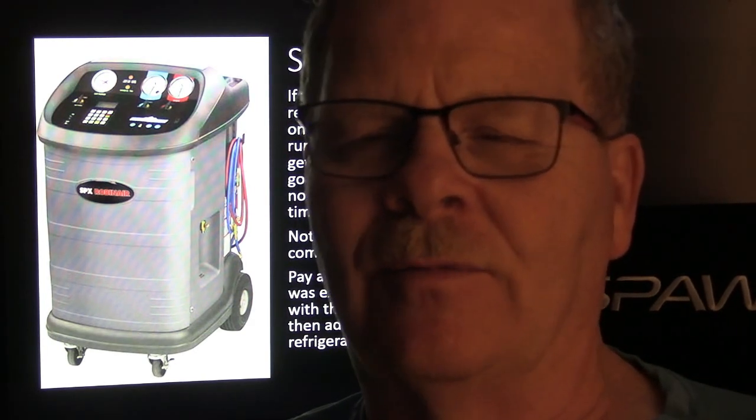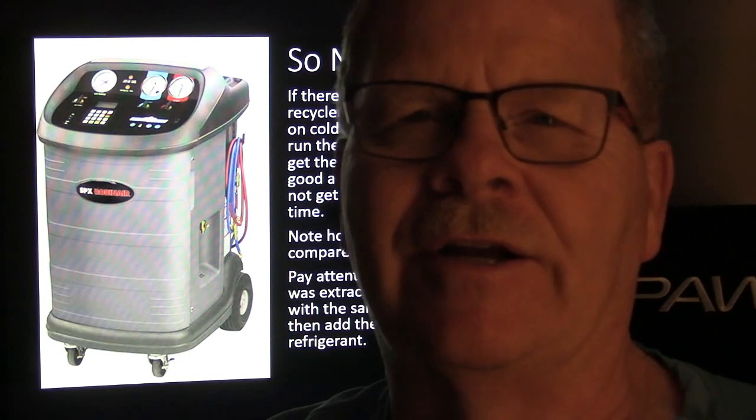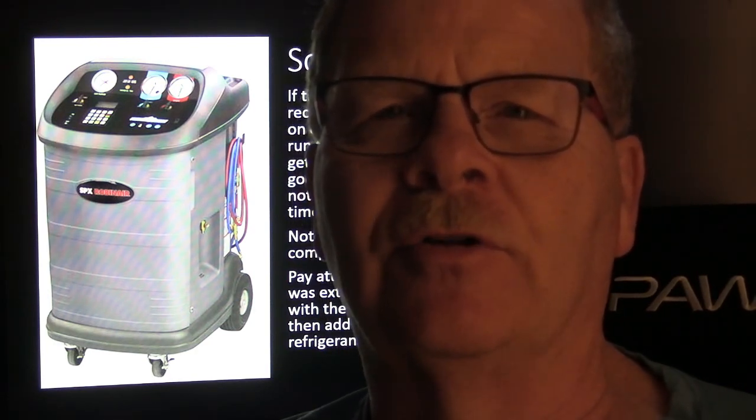I would periodically use my yellow Jeep that I used to drive to pull refrigerant out and put it back in, because when I thought it wasn't quite cooling good, you could pull it out, measure what came out, and put the right amount back in, right? Well, I pulled it, and I went in my office, and I was there by myself, and I went back out there, and I noticed it had outgassed a bunch of refrigerant. Outgassing means that it has bubbled out of the oil that it's mixed with, kind of like a Dr Pepper or something. And so I turned it on again, and I got some more out, and some more, and I added all those numbers up. That was a 1.25-pound system, and I pulled 2 pounds of refrigerant out of it, because I had never completely evacuated it, since some of it stays trapped in the oil in that accumulator.